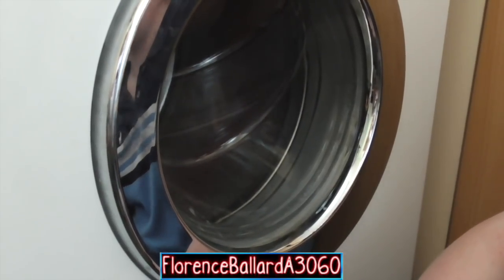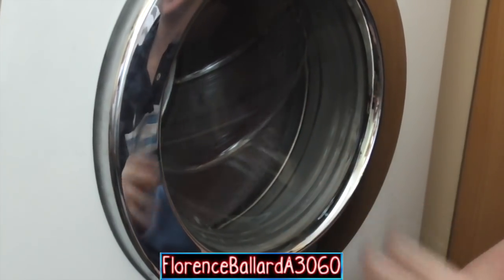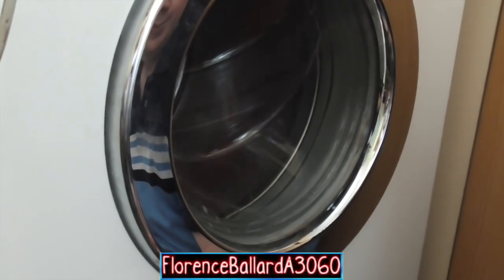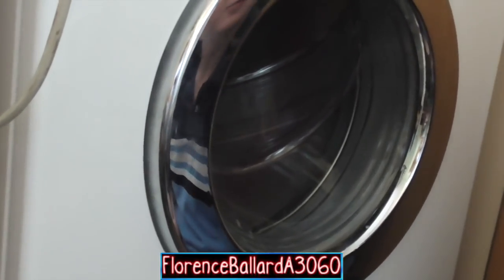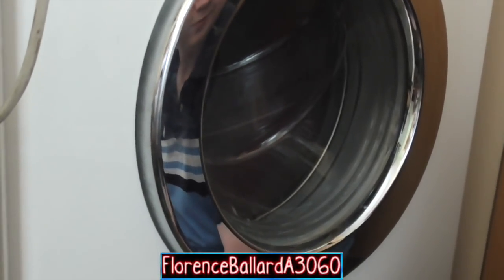But if you put easy iron on, it will do the spray with the jet for about 10 seconds, and then it will slow down. I think it gets up to about 600. The old Miele's, like the W800 series, their progressive spin started right from distribution, and it would slowly climb all the way up to 900. It holds it for about 3 minutes. So you get quite a good spin on this, actually.